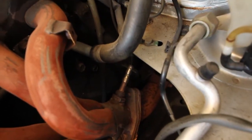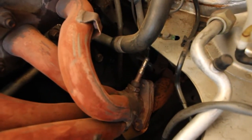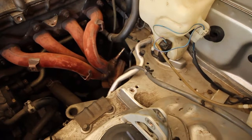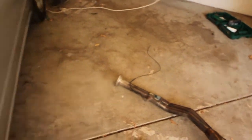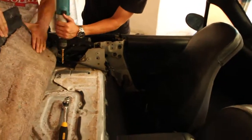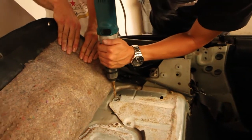So, the O2 sensor is right there on this one. Yeah, the O2 sensor is up high on the stock headers, and it's down low on these ones, which means we can't just unscrew the factory one and screw it into the new ones. We have to splice the... Does that mean we need to splice it before we actually try it? Yeah, it does. So we've got a bit of work to do. Let's do it. It shouldn't be too bad. Trying to drill through the factory weld on nuts underneath this. So then I guess you can just bolt this bed on that.